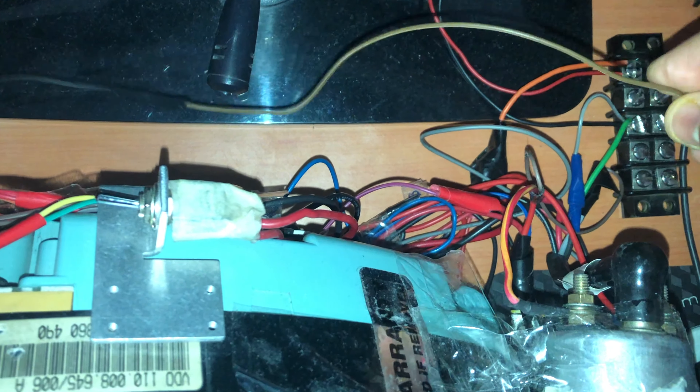To begin, you need to first put the ignition key in run mode. I'm going to put it in the on position first, and then put it in the run position. This will turn the ignition on. After that, you need to connect the SIA pin to ground.